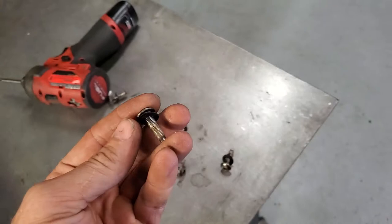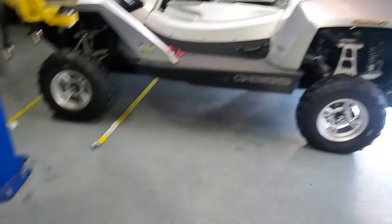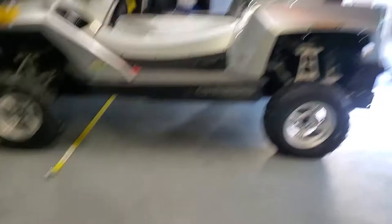These are the bolts — they're T30s on mine. They have these little plastic washers that help prevent marring the paint surface. Don't torque them down too much; a good 7 to 10 Newton meters really should be good. If you do it too much they will crack the bodywork, and they're really pretty machines, so try to keep that fresh looking.